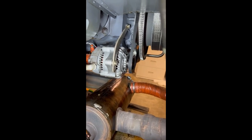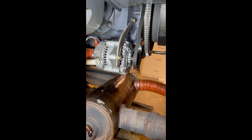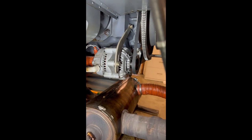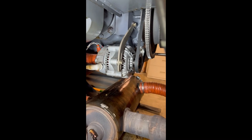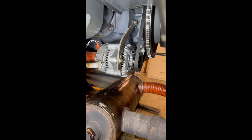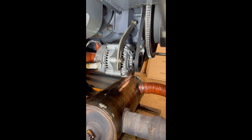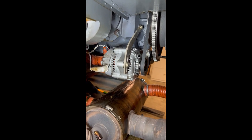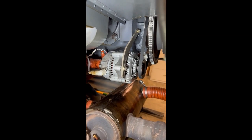I thought I'd show you guys one thing: whenever you put the crankshaft seal in, one of the things you also want to replace is the alternator belt. Might as well go ahead while you've got the thing all torn apart and put a new alternator belt on — a little extra insurance. Because it takes just about as many hours to put an alternator belt on as it does to put the crankshaft seal in; you've got to tear the whole back end of the helicopter off to replace the alternator belt. So anytime you've got the cooling fan off, it's a good idea to go ahead and put the new alternator belt on.